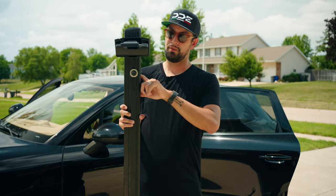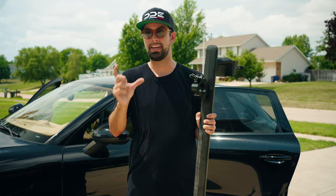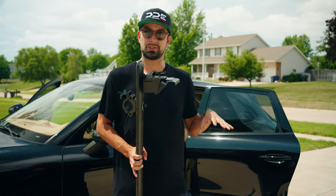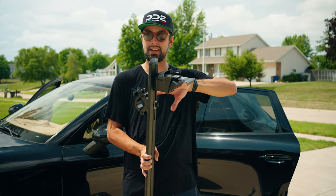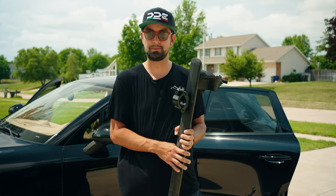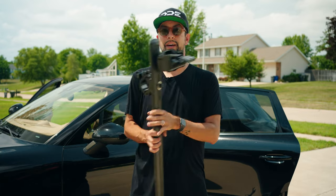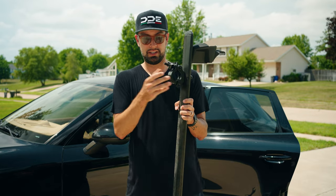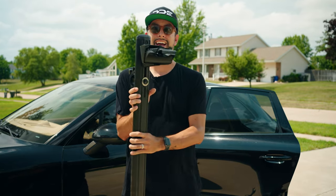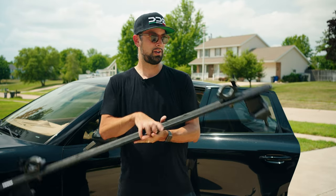And for me to be able to attach it to this, the screw wasn't long enough. So what I did is I took the screw that came with it, I went to the local hardware store, and I matched up the correct thread with the correct length that I needed. And I brought this with me to make sure it would fit. I measured the width of the bar that I needed it to go through. And then I came and got this Evo, took it off the car, and I drilled a hole so that the screw could go through the Evo and then attach to the other side. So I got washers on this side with a lock nut. And so this thing is not going anywhere. I have it for each side here.